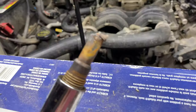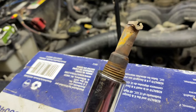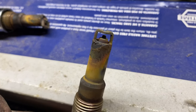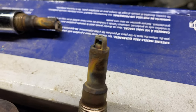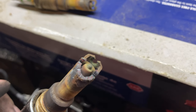We have a wild development in the spark plug changing video. This is the plug we pulled from the back cylinder — the one Dustin had the breaker bar on — and as you can see, the electrode is actually broken. We're doing this on a hot motor, which helps with carbon buildup and reduces the risk of breaking plugs. We're doing everything by hand, but some people will use an impact. Look at the electrode — it looks like it's been broken for a while. It's got some buildup on it, so it definitely looks like it's been like this for a bit.